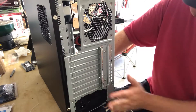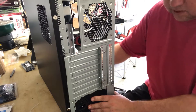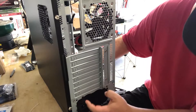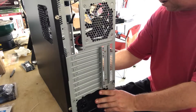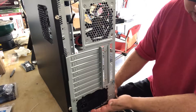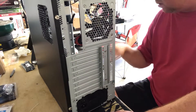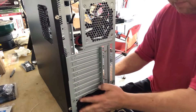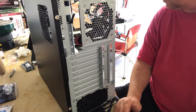Alright, I wanted to grab the case and sure enough, I flipped the power supply upside down again so the fan's facing down, and I was able to figure out how to get the screws to line up. It's designed to go both ways. This case has a removable filter — the correct way, in my opinion, is fan down in this case. So we've got that all tightened up and we're going to move on to mounting the motherboard inside the case.